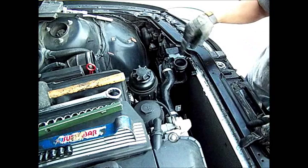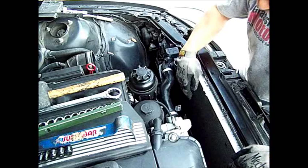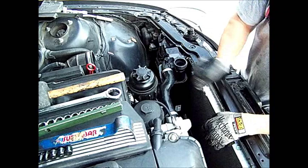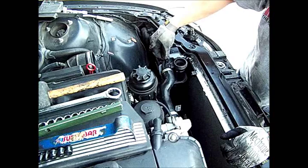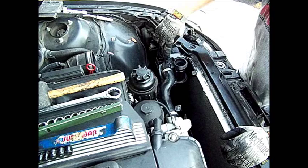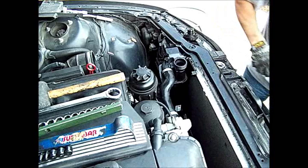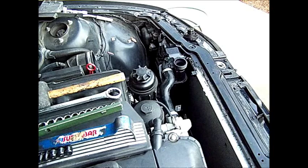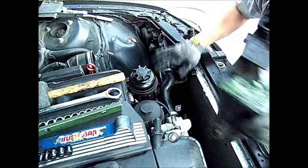Go ahead and fill up the system. Put in your air box, fill up the system, put on the bottom pan, put in the fan again with the fan shroud hooked in properly — then do a counter-clockwise tightening with the 32mm for the fan. Get it running warm, then open up this valve here and it will bleed until it spills out, then tighten the screw back up. That will have bled the system completely. When the system is full, the red float in the expansion tank will be at the top — that indicates it's full. And that's about it — you should be good to go.